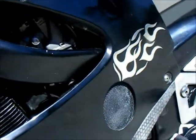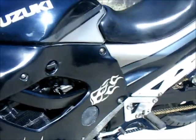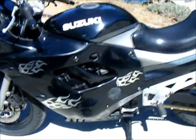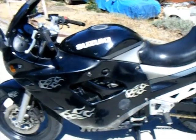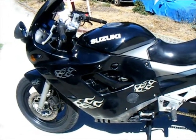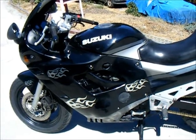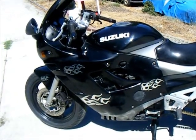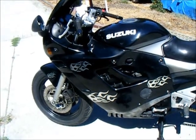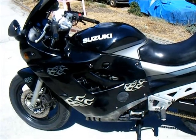I think you can see the pods in there. Stage 3 Dynojets on it — these are all in the pictures too. We went up three stages on the main jet and also on the pilot jets, so it's tuned in. We took our time tuning it. You don't want these to run lean when they first break in, so we were very careful with that. And it's not running rich either.